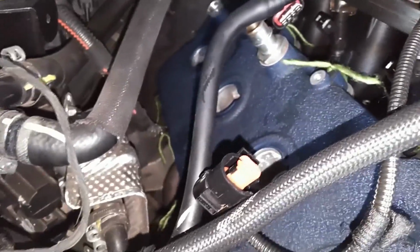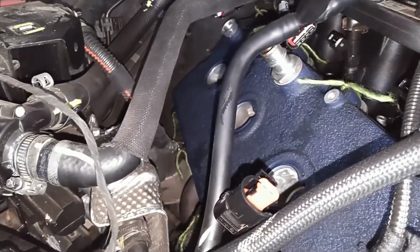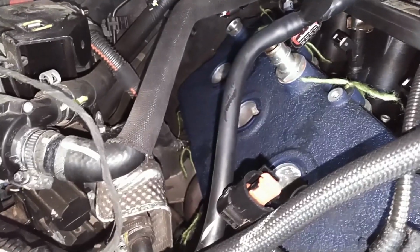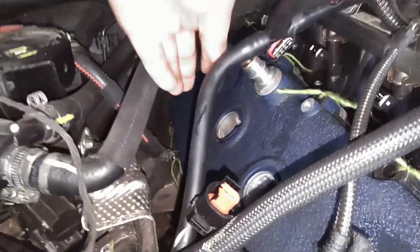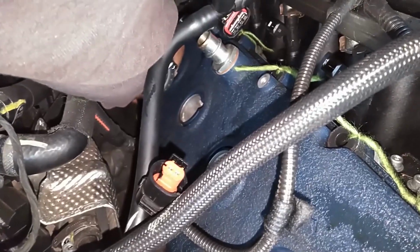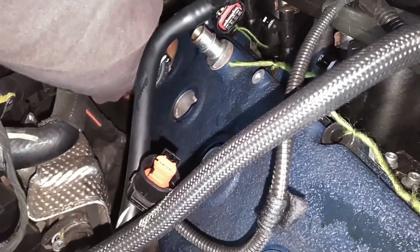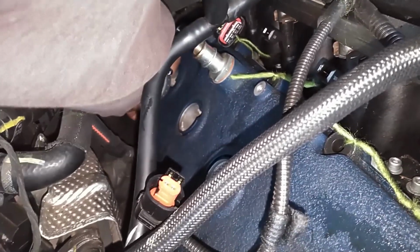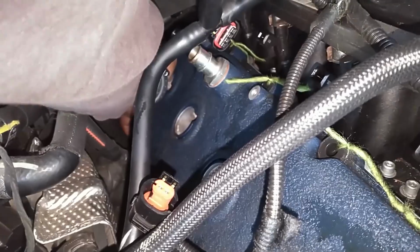My second attempt to put the valve cover in was another fail. So I am to a high-tech solution. Get some yarn, a zip tie, some dental floss or something, and tie in this end of this cover gasket. You see how I have that in there? Now, once I get it in place and set and feel this tab back there that is in right, I am going to cut the yarn, slide it out, and I should be good to go.